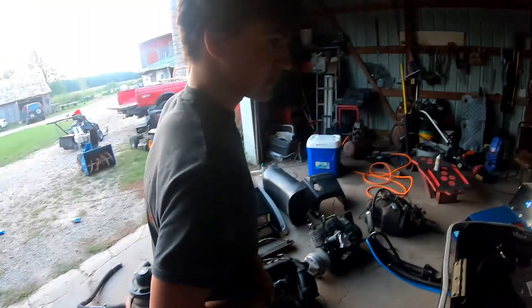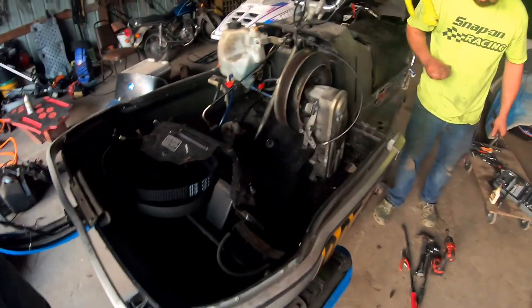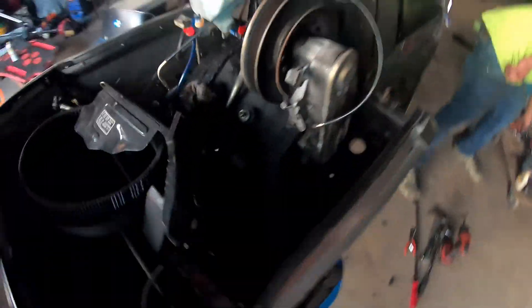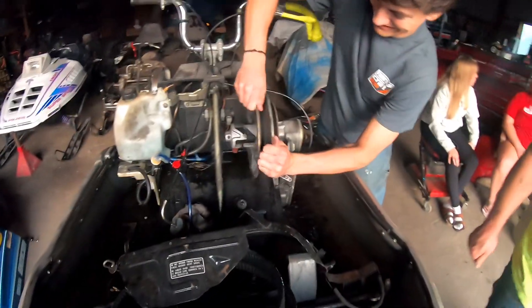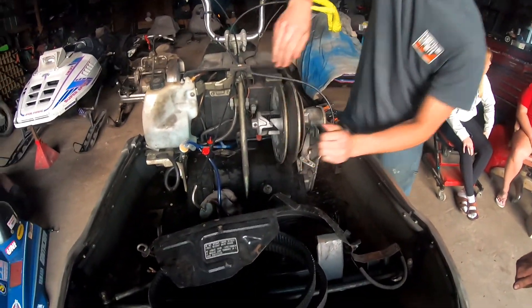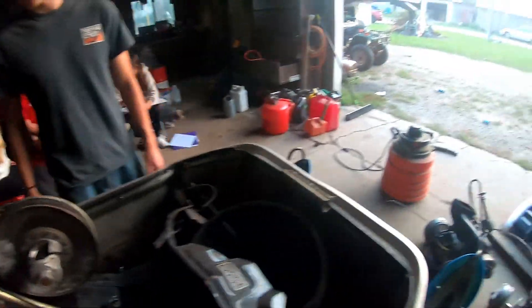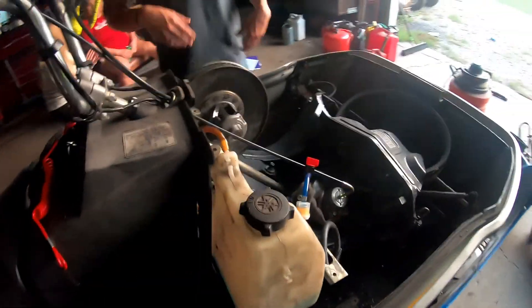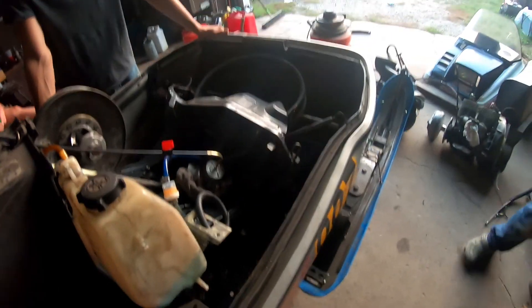Boys, motors out of the Enticer for weight reduction purposes — we're not gonna put it back in. Sullivan arrived and took his KX for a rip, sounded pretty good. The secondary clutch needs much attention — it's very sticky guys. Look, it barely moves back. That should be very, very snappy. That's what controls your shifting and back-shifting and your top end speed. That must be fully shifted out. We're gonna have a hard time spreading it apart. That's how you burn your belt.